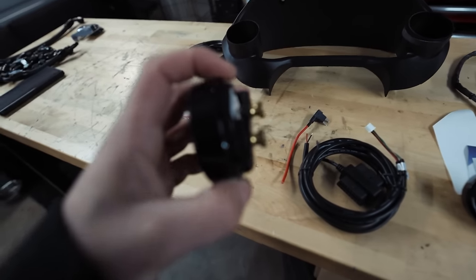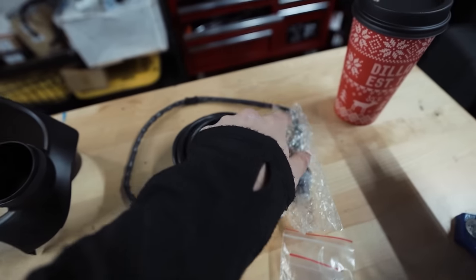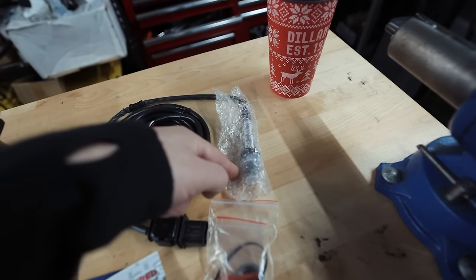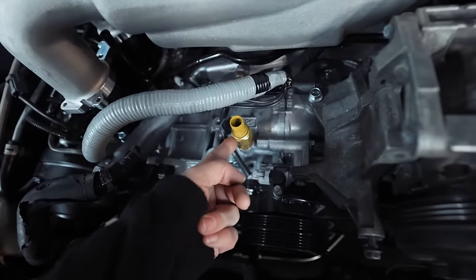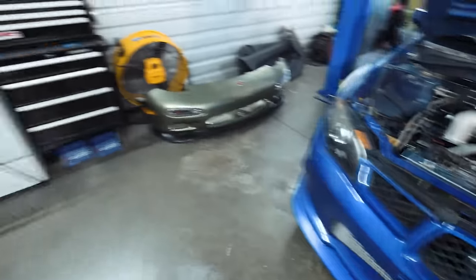The best way I found is to add a little bit of JB weld on that rubber band and then JB weld them in. For sensors, we have their O2 sensor — these things like to die from AEM. I've had them die within the first five minutes sometimes, and then you have to order a replacement. I'll link below the replacement and the gauges we're using. I've already got our oil pressure sensor installed, so this shouldn't be too bad.